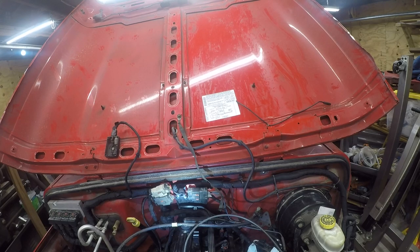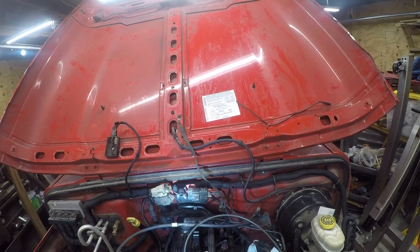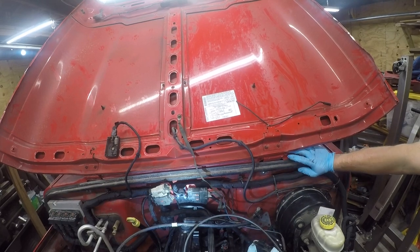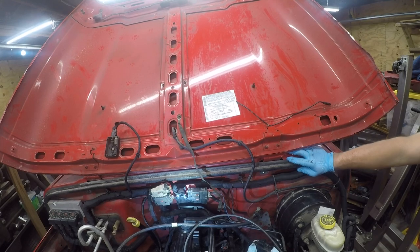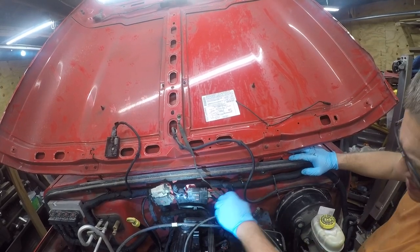So, the real question is, where else could the vent tube go? And I honestly want to relocate it, because I want to add the transmission one. The transmission one doesn't go high enough, in my opinion. They both need to come up really high on the firewall. And you know, same thing for the axles. They need to come high on the firewall and away from the exhaust, because I have a hunch the exhaust is hot on this vehicle.